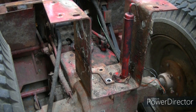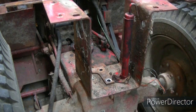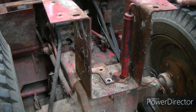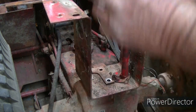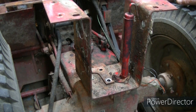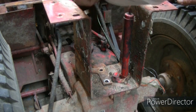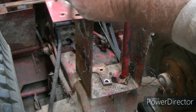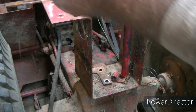You should consider trying a new gas line. We got the part. I just ran new gas line. From front to rear? Well, maybe up to the... Do they have a metal line in between? No. I ran it from here up to the filter. I think it's leaking ahead of the filter. What the heck is this for? It was just sitting here. It's not a vent. Unless a line... Oh, is that what the gas line originally went through or something? I don't think so.